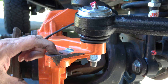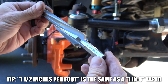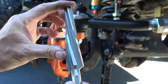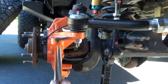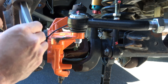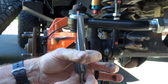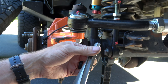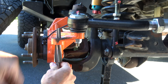What I'm going to do is ream this out using this tool — it's a one-and-a-half per foot taper, a standard GM one-ton automotive taper. It's the same taper that's already in the Reed knuckles and in the factory knuckle; the depth is just going to be different. How far the reamer cone goes into the knuckle determines how wide the smaller and wider hole are. So I'll take this and ream it out, making that hole a little bit deeper than it is right now.